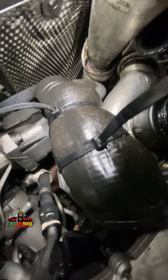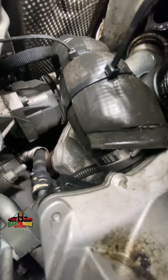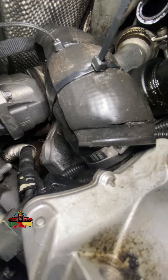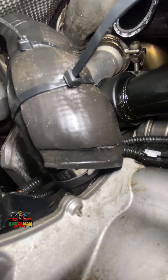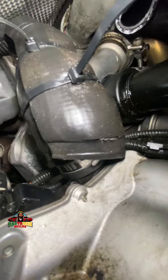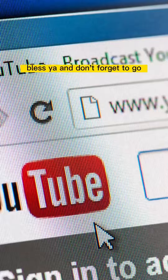So this is what we did: we made a little umbrella for the new hose out of the old hose — slit it and put a little umbrella on it, so when oil drips down it cascades over and doesn't just sit on the new rubber. A little unorthodox, but we have to do something instead of doing nothing.